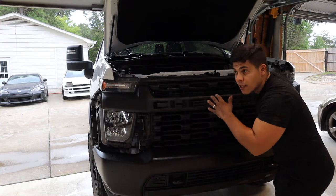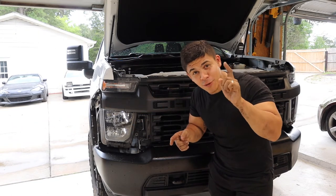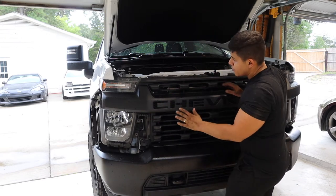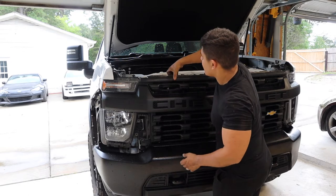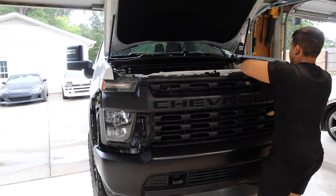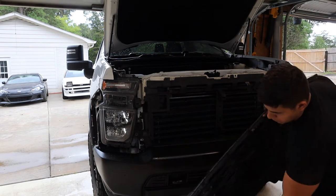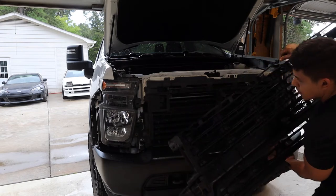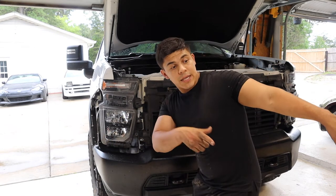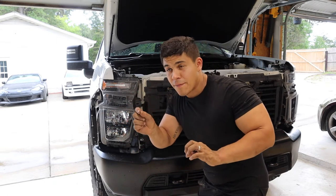Full disclaimer — we got the other side done and I went ahead a little because the camera died. Still haven't bought another battery pack. So we jumped to the future a bit: the grill comes off, but you have to lift up on these little corner tabs because they have a little hook even after you get the screws out — lift it up and pull back a touch on each side. It's got one clip here, one here, two here, and another on the other side, and it literally just clips in and out. If you were done with your conversion this is where you'd clip the new grill in and reverse the process. Pretty easy.